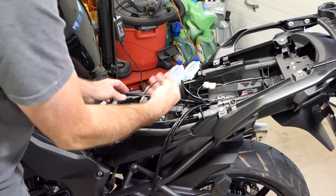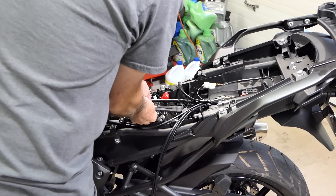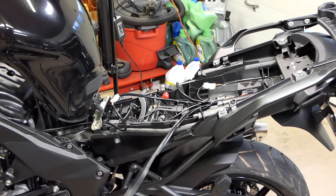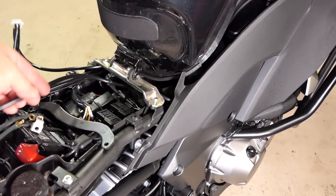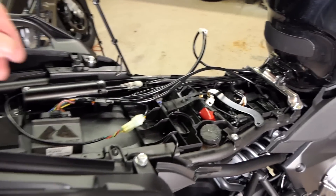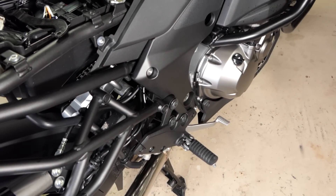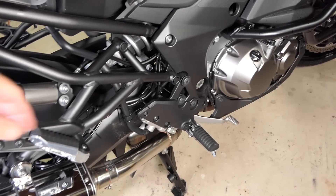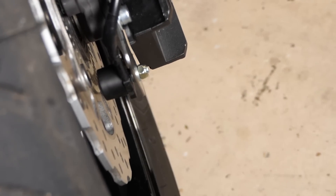There's a ground wire here that goes to our battery, so I run it over with the other ground wires under the strap. The remaining wires go underneath the tank mount and forward along the left side. We've routed the speed sensor wire out of the harness, underneath the bracket, down the outside of the frame, and chased it along the brake hose and sensor wire that runs back to the caliper. We plug it into the speed sensor we installed earlier and lash it in place.